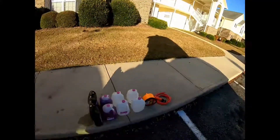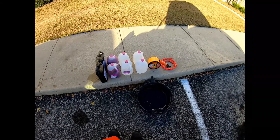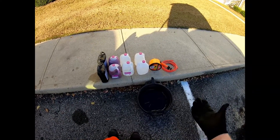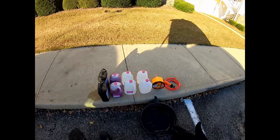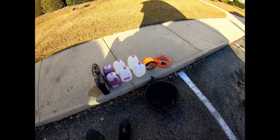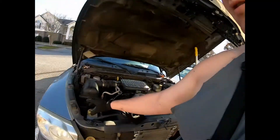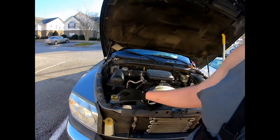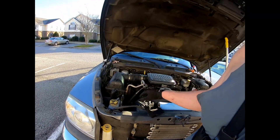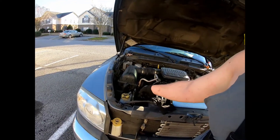What's up guys, today we're gonna be doing a coolant flush and refill. Here are some of the things you're gonna need — I overbuy. The manual says it's got about four gallons of coolant inside the motor, but I don't know if all that's gonna drain out. The basic premise is I'm gonna pump out the coolant from the reservoir, open the petcock on the bottom of the radiator, drain that out, and then fill up the radiator with water. Fill the coolant reservoir with water up to the full line — don't fill it all the way to the top.